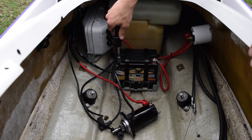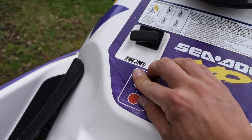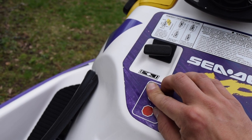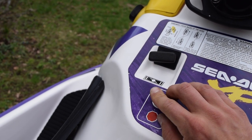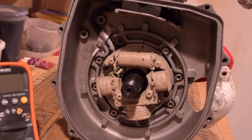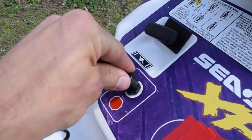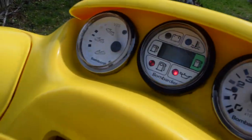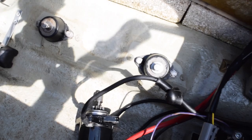Now, based on my very limited electrical knowledge, everything should be plugged in and working, so let's see if I get the two beeps. Sick. After some light troubleshooting, I discovered that the MPM gets its ground from the stator through this plug, so I ran a ground wire to the battery, then waited to film until my yard was full of girls and dogs. Holy shit, it works — just the starter motor.